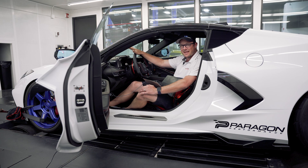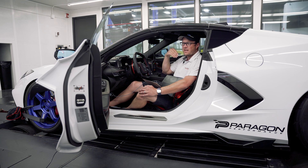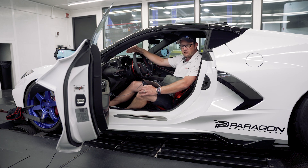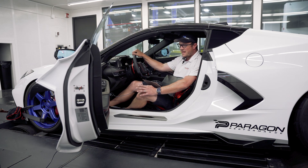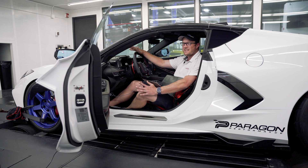The RC8 was actually one of the first ones to get a ProCharger on it, so we've had it on here for a very long time. Initially, we tested it with some control modules that would delay the ignition and clamp different signals, then we tested it with Pites's Delta Control Module, which gave us a bit more control. Finally, ProCharger worked on developing a flash tune for the ECM — we had to mail the ECM off, get it back, and put it in. They did develop a tune that could go with the ProCharger, kind of a one-size-fits-all, and we tested that as well. It's definitely gone from frustrating to less frustrating to getting better and better, and that last iteration from ProCharger was a huge step in the right direction.